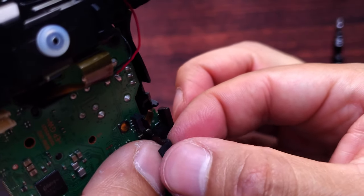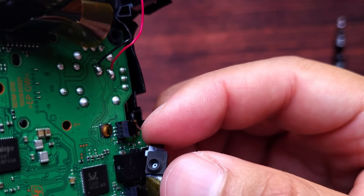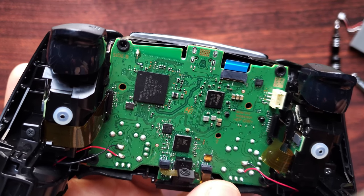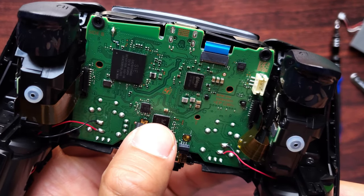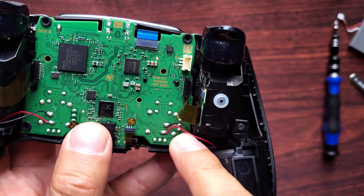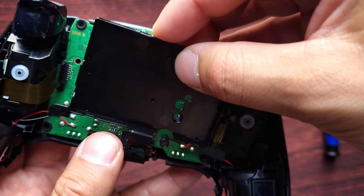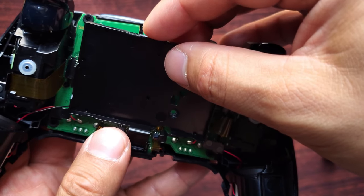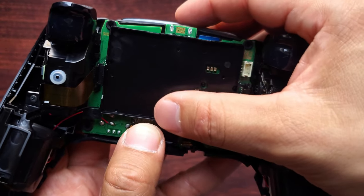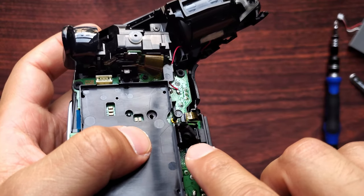Place the pad in, close it, and you should be able to see that little dot showing through the hole of the pad. To place your battery holder back on, grab the little wire, put it to the side. These ends can hold your rumble cables, so place it so those wires end up being under the battery holder. Then place that wire back on.